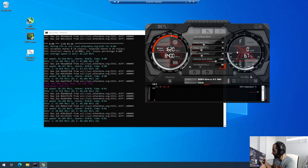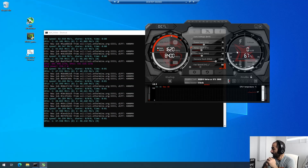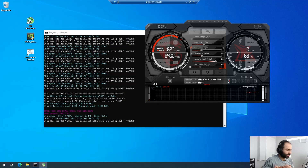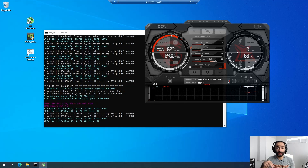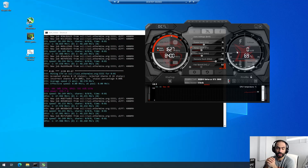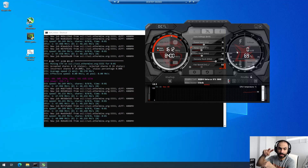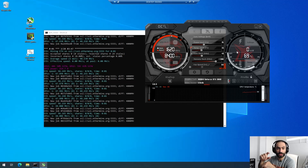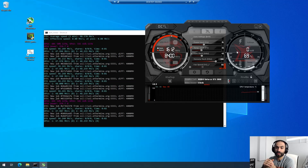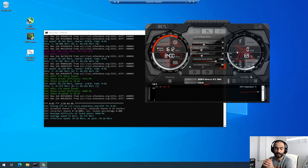So that's going to be it. The Z390A Prime from Asus works. It's about $200 to $230 on Amazon. I put an i3-8100 CPU on it, a 750 Watt PSU, and just a regular case. You do need to plug both cards into a display unit or display dongle — I showed a link for those in my previous video. Basically any motherboard that can run in X8, X8 mode — two times eight PCIe lanes, version 3.0 — coupled with developer driver 470.05 and some minor overclocks should get the job done and get you more than 48 megahash on each card.